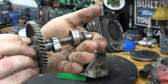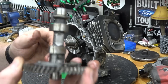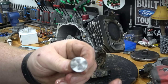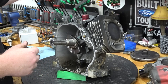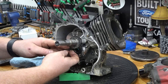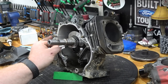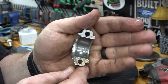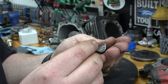Our cam lobes look real nice — there's no pitting on them. I don't remember what cam this is. Our tappets, or lifters, look real good. I don't even think these are stainless — I think these are stock lifters, a little cheap. Grab the crankshaft and give her a squeeze and I break them loose, evenly. Oh, rod bearing — doesn't look too shabby. I mean, she was getting some wear on her. This is the rod bearing — still looks great though, there's no gouges missing or nothing.